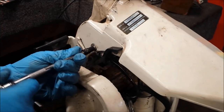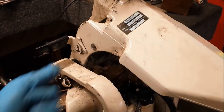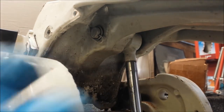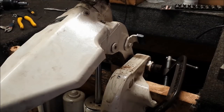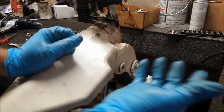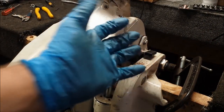Now there's a little screw right here that's got to come off. For the trim sender, we've got two tiny little quarter-inch screws. We have this pin right here — it's got to come out. Now this little hoop goes that way, so this is in the dumbest spot possible. I'm just rotating a little here. The first clue I have that this is going to come out is the simple fact that it turned — the last one didn't do that. I have the thing supported via chain so it doesn't come crashing down. This is the tilt lock.